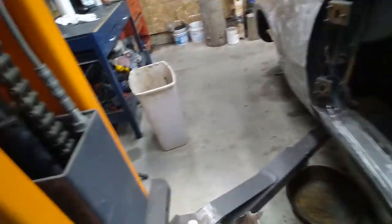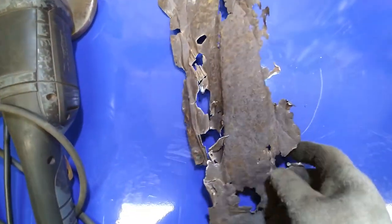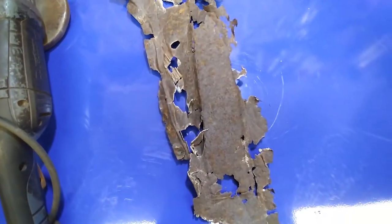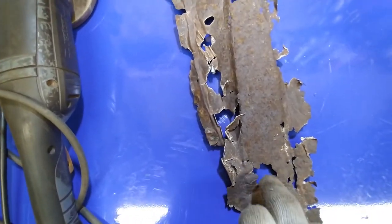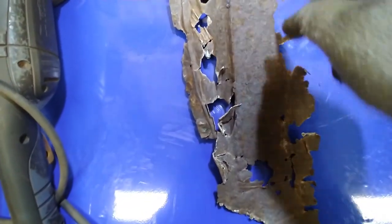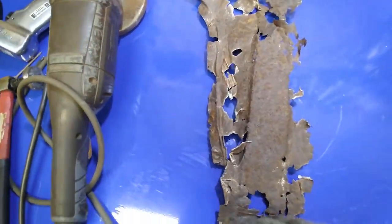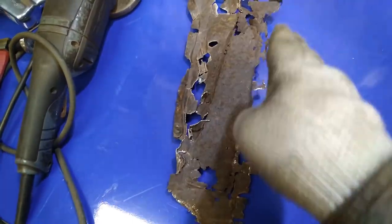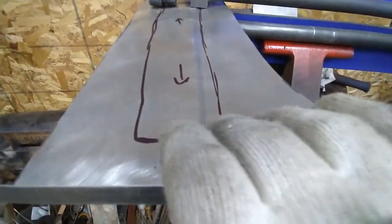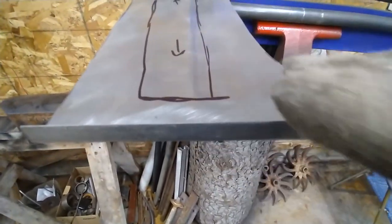Here's the model piece - it's got a little bit of a crest in it. There's supposed to be a hole there and a big hole there, down to here where there's supposed to be another hole that lets air out. It's got that bit of a curved shape on it. So I put it into the bead roller for making those shapes and I've got one side done right there. I'll see if I can make the other side - I'll set up the camera so you can watch this happen. I've got it set up in here, this is screwed down - that's a one-eighth inch thing. You've got choices of one-eighth and one-quarter - just screw it along and follow that line from one end to the other.